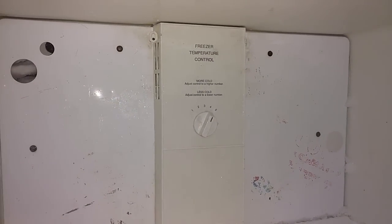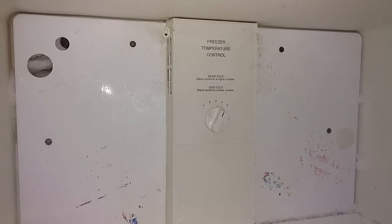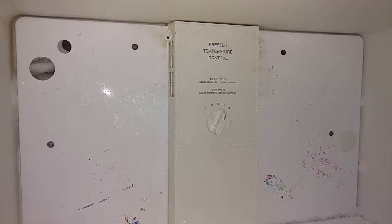I'm at my mom's place. She's having problems with her refrigerator — it is not cooling properly, and it's building up ice inside the freezer area. Normally when that happens, you have a bad heater element or a bad timer.